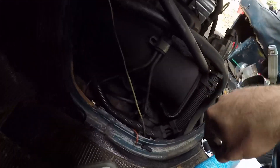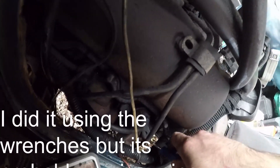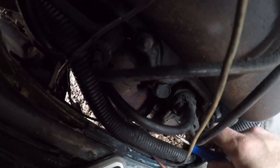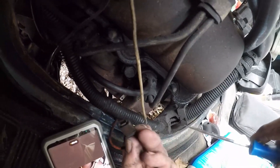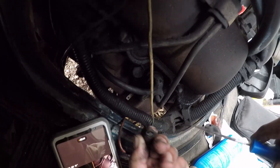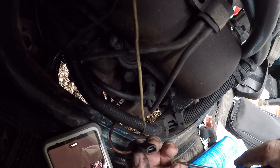It's very important to note that we're not going to try and remove the glow plug on the driver's side from up here — I'm simply showing you the location so it's easy for you to see what the glow plug looks like. You'll see there's a little plug connector here, and you basically grab the black part and just pull it right off. It's not even held on with some kind of mechanism, which is great for people who hate connectors.